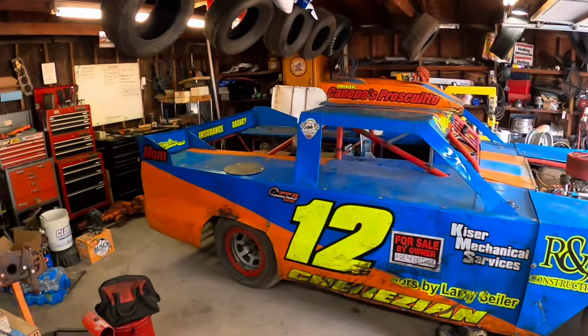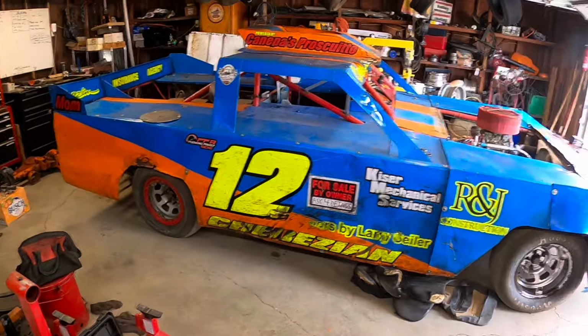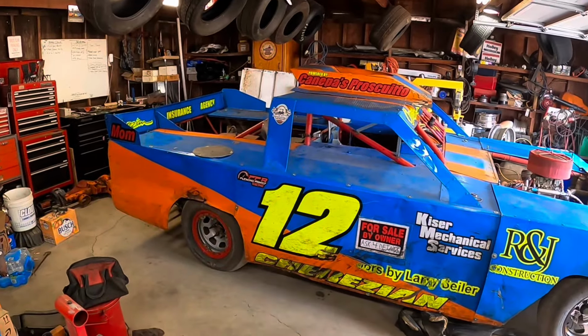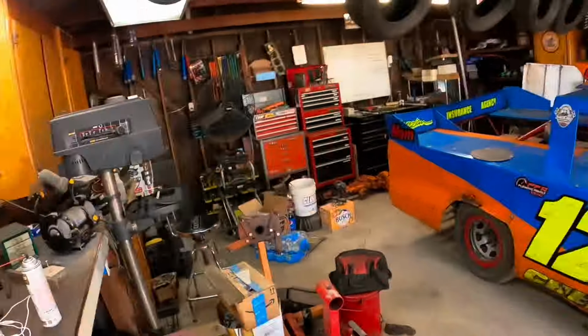The changes I made on the setup plates the week prior, I went in the wrong direction. I moved the rear end this way a little bit and also this way up, and both of those, I think, hurt the car. And so the car was definitely better the previous time out at Antioch, with a little bit more side bite. But I just was spinning tires. I couldn't get a hold of anything out there at all.